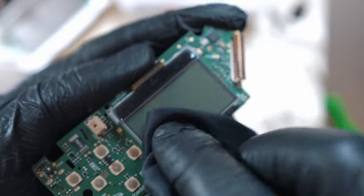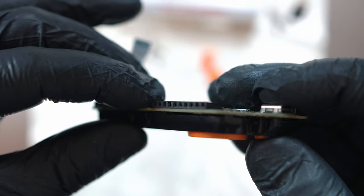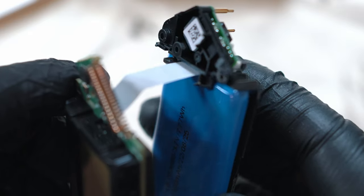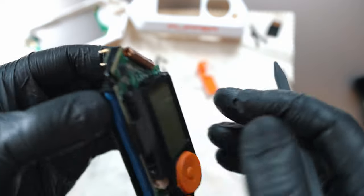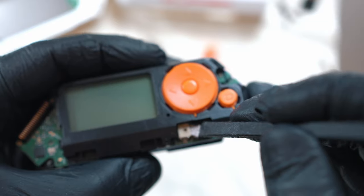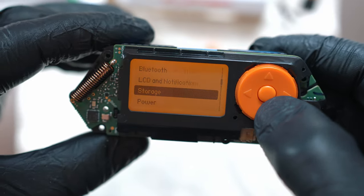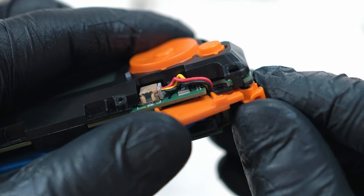I'll clean fingerprints and start assembling my Flipper Zero. The main point of this was to see inside and check connectors and components after the first month of use. You need to feed the ribbon cable through the tiny opening and click the two pieces together. As soon as you plug the battery, Flipper will power on, so just power off and continue. Make sure to properly fit this cable guide and SD card frame.